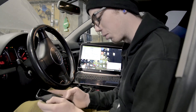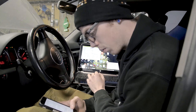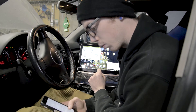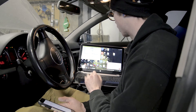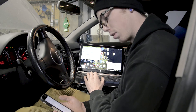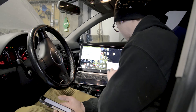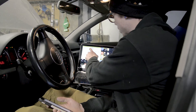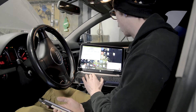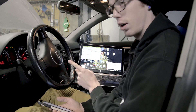Give me a minute to figure this out. Okay, so — select engine 01, connect, then basic settings — 04. Type in the group: 060. Hit go. At the top of the screen it says basic settings off, so I'm going to turn that on.